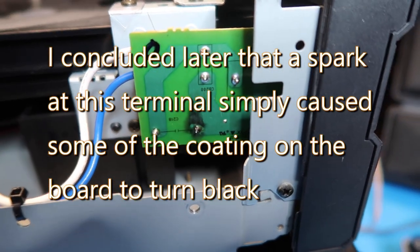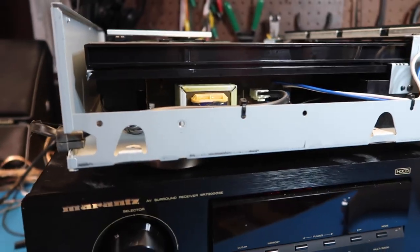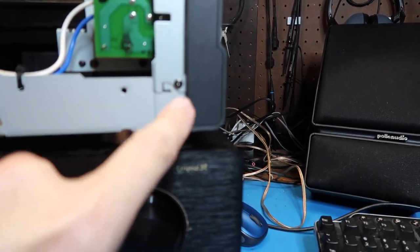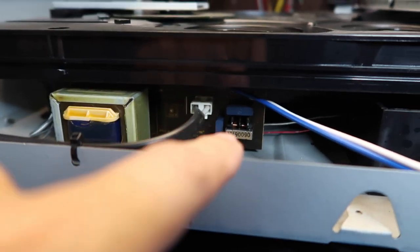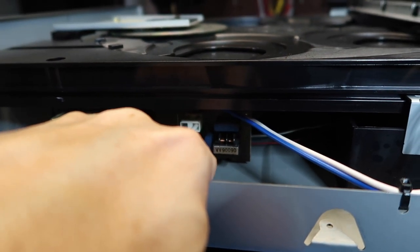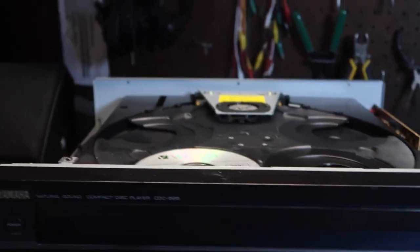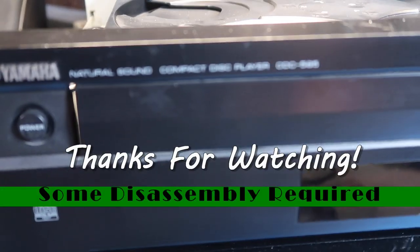This view gives us a couple of insights into how it's manufactured. The power cord just slips in from the side with the back taken off, but with the back on you can't get it out again. The front panel is a whole assembly that slips on top with a few screws and a cable. Under here I can see more of the power supply board. This might be a fuse here — this blue piece — along with some sort of dual choke transformer. Probably on the other side is our full-wave bridge rectifier. So that wraps up our video on this Yamaha Natural Sound Compact Disc Player CDC-585. Thanks for watching and bye-bye.